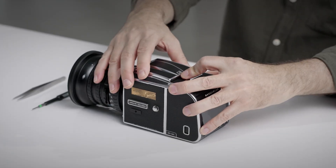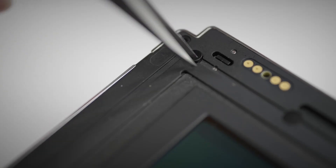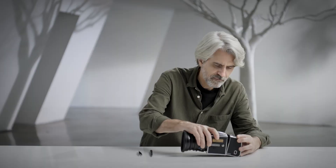After the shutter timing is adjusted appropriately, detach the digital back from the camera, put the cap back on the screw hole, and then mount the digital back to the camera.